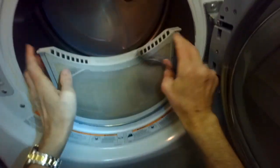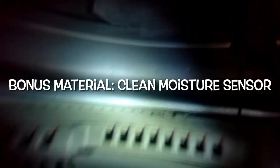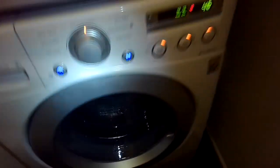Another piece of bonus material: clean the moisture sensor, which can get a waxy buildup on it too. You can use Windex or alcohol — here a wire brush is used to clean the two metal bars that make up the moisture sensor. You want to get those metal bars as shiny as you can. Alcohol or Windex both work; this method uses abrasion to get them super clean.